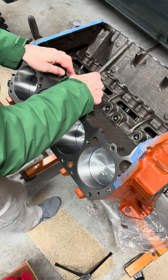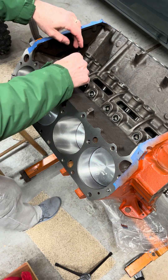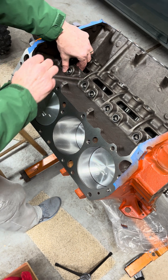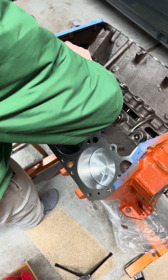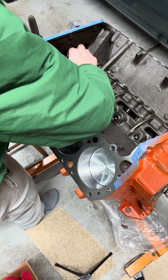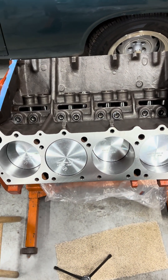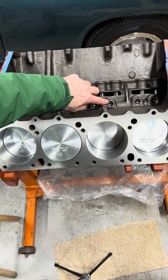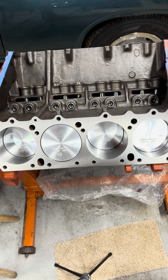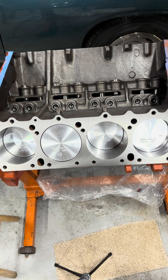Mine seems to be running really nice, so I'm happy with that. Here goes the last one. You can number these when they're all done and keep them in order in a box. They seem to be going smooth — you can see the little black marks are lined up pretty much at 12 o'clock. Now we're going to rotate it over. It says you can do up to 16 turns, so we're going to run it real slow. I'm going to start turning that sprocket over and see what we get.